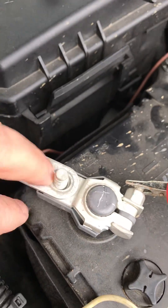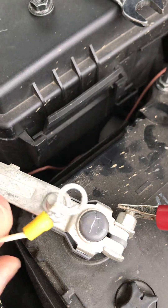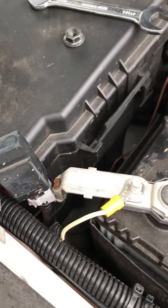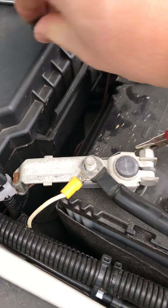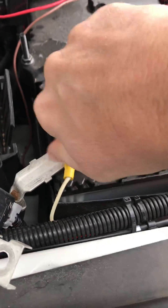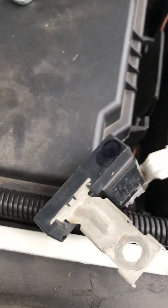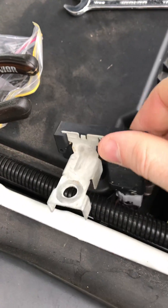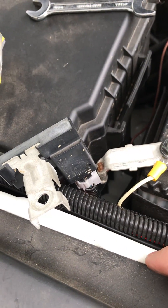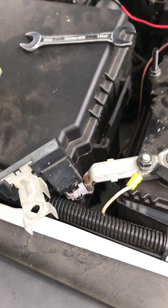To keep the plug clean you can just leave it all plugged in and tuck it off to the side. Put your negative terminal back on, brake controller back on, winch cable back on, put the nut back on. And effectively we've just disconnected the smart alternator. Later on you could unplug the plug, put a bit of plastic bag over it and seal it up — that's like a 30-second job.